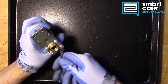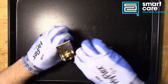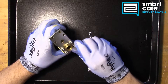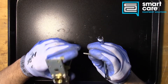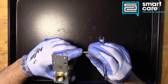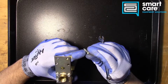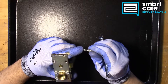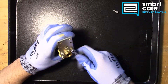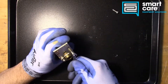So while I'm taking this apart, let's talk a little bit about threads. When you see these little lines inside of an opening, that's a thread. You can have an internal or external thread, and there are different standards for threads — how they fit together, how they seal, and how they form their pathway. This is an external threaded fastener; the thread runs around the outside. It's made for something soft like plastic or wood because it's really coarse, with a lot of spacing and it's really sharp. The threaded opening in the brass part is most likely going to be a hose style or pipe style thread — we call that NPT.